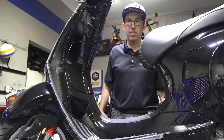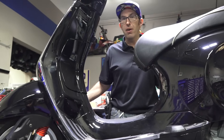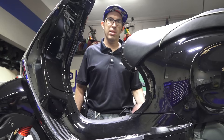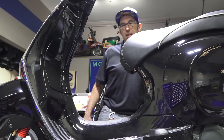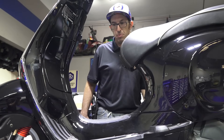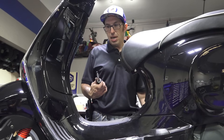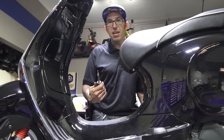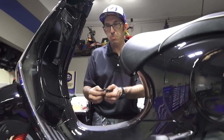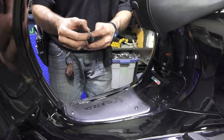The fourth item you want to check occasionally is the battery. The battery is a wear item, much like a tire — it has a limited lifetime and you're going to have to replace it at some point. If it goes all the way dead and won't take a charge, you need to replace it. To check your battery you'll need two tools: a Torx driver with a T25 and a T30. Your tool kit that came with the scooter will also have all the tools to remove the battery if needed.